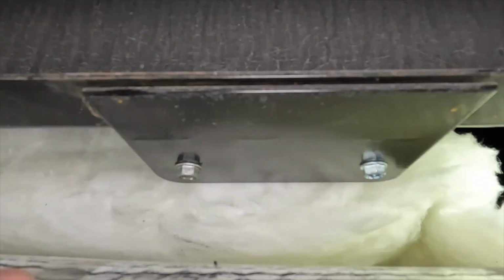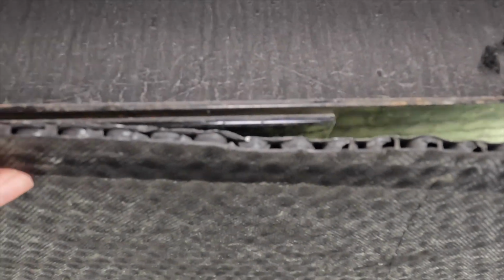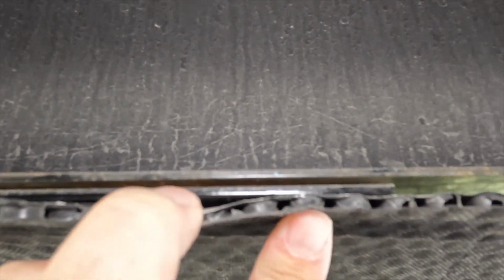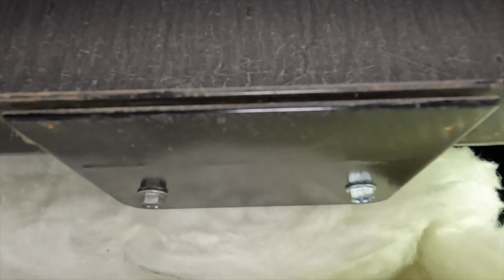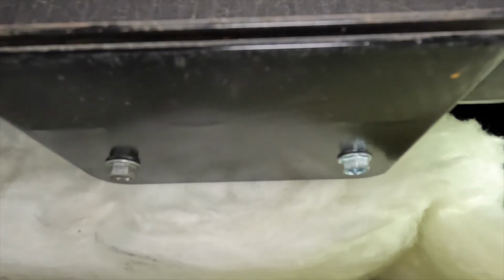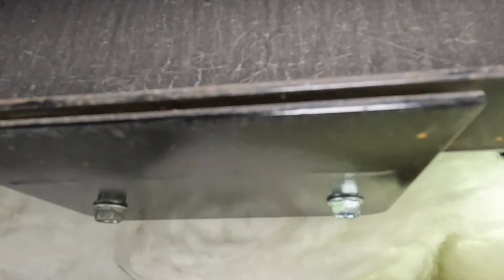Now, let's get back under there and see what this sensor looks like. Here we go. I actually just figured out that you can see this bracket without even pulling the underbelly down, guys. If this was up in place, you can see there the 2 layers of metal. That's the actual bracket that holds the sensor we're looking for. So by first inspection, it looks like it is in place. You can see these 2 bolts here, the same kind of bolts that came off of the underbelly pinning. So that's a good sign that it's in place, and I can put my hand up there and it doesn't move around, so it's in place and solid on the bracket itself.